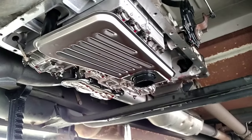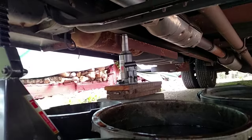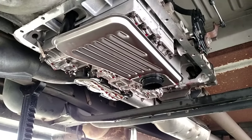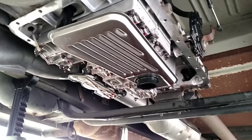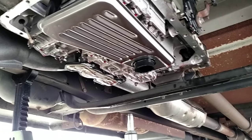The fluid filter goes up in there, sucks the fluid up into the filter and into the transmission, circulates, and does all that good stuff. Part of what we think is our problem — I can see the new filter — is that this pan requires a deep downspout. You can kind of see the two together: one short, one long. That could cause the transmission, especially on inclines, not to take up enough fluid and possibly slip, shift hard, or come out of gear — which is all the things it was doing. So hopefully with the sensor I put on yesterday and the fluid change, we can address that. The fluid is almost brand new, but I really wanted to check the filter based on what people I've talked to told me.